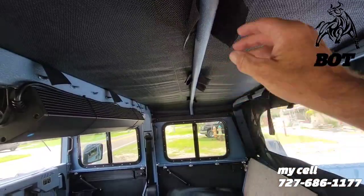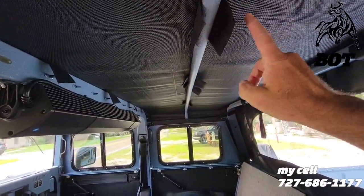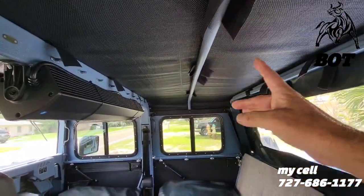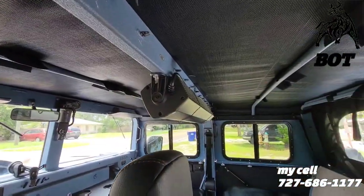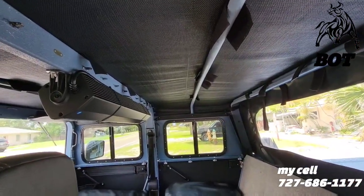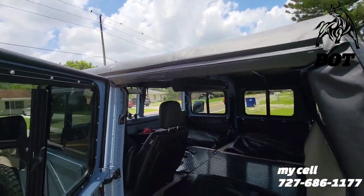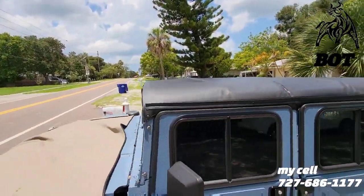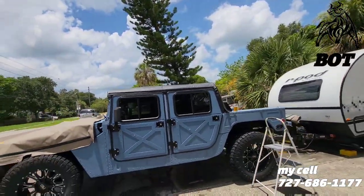The velcro runs in a straight line around the crossover tube - not forward of it, not behind it, right dead center on the crossover tube. That's where it should be. If it's not there you're going to have a pool of water here, there, and two more pools up front. It rained last night and this top was on - I did have some water up here but as soon as I moved the truck it ran right off. Anyway, it's a nice top - Vinnie, this is yours, and another one just like it is going out tomorrow.